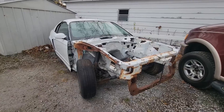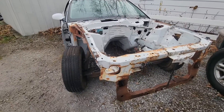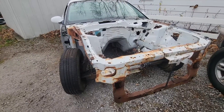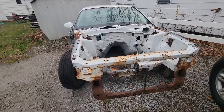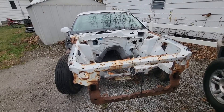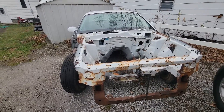When we were doing that, I started thinking and throwing some ideas around. With going with a tube front end, a lot of these cars have an issue where you cannot put long tubes on them without dropping the K-member and everything. But if we're going with a tube front end, we can just slide them in from underneath. There are some inherent benefits to going to a tube front end, in addition to just being cheaper.